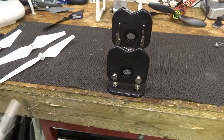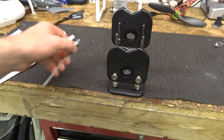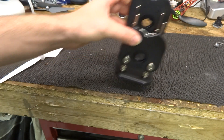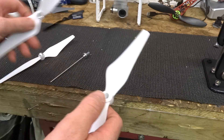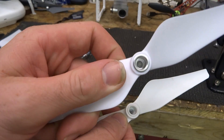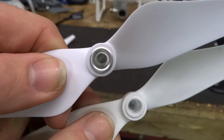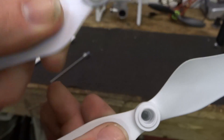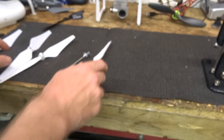And that's it — straightforward is that balancing props. Remember: do not fit normal metal hub props to the Phantom 3 if you want to keep your bird in the sky. Only fit it with the composite hub props. Again — metal has a silver insert, composite is the same colour as the prop, so you can easily see the difference. Metal. Composite. That's it. Thank you very much for watching.